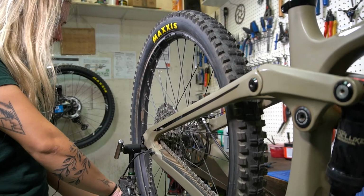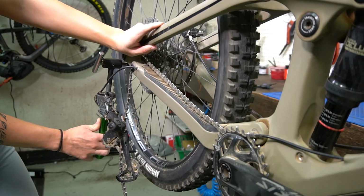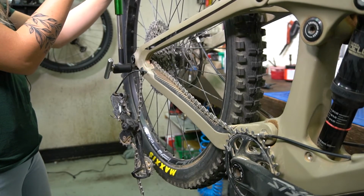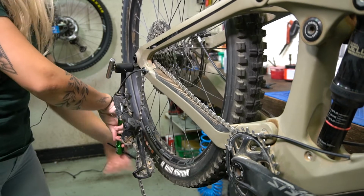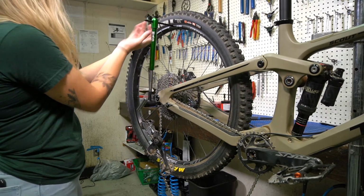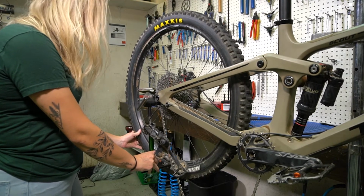Is this going to be a constant process of checking? Yep, it's a process of going back and forth and checking your alignment at the top and then doing the bending from where you can see it's not straight. Ooh, we've made progress. All right, let's go back up to the top. Okay. Was that it? Was that the one? Let's find out. Let's go ahead and check the top. I think I did it. Awesome. We're at the rim edge. Edge. At 12 o'clock and 6 o'clock. Rim edge. All right, there we go.